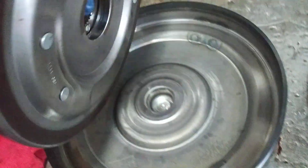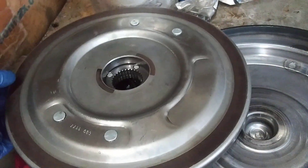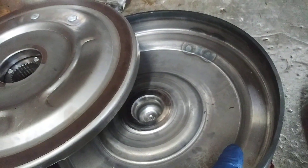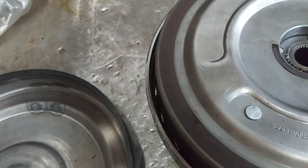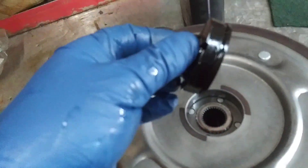There is some slight slippage that is okay — under 50 RPM is acceptable — but the clutch has to be locked against the cover by hydraulic pressure. I've taken quite a few of these apart and seen the clutch completely wiped out, metal-to-metal against the cover. That's not the case here. What happened on this one is the sealing surface O-ring was busted.